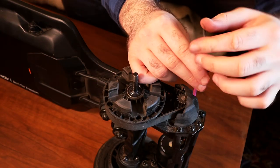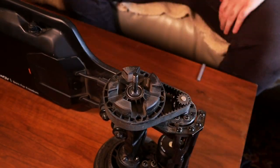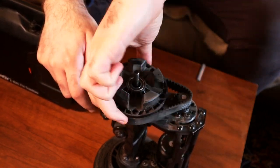So of course the Atlas will have the option of hubs and direct drive in the future, but for now the only available option is the Riot motors, i.e. belt drive. Naturally, a belt driven board with 4 motors attracts double the maintenance of a belt driven board with 2 motors. In the long run, there will be 2 more pulleys to worry about, 2 more pulley bearings, and 2 more belts. That's not a negative per se, it's just something to be aware of.